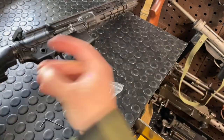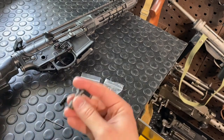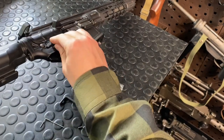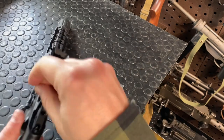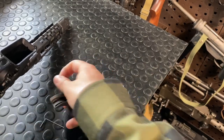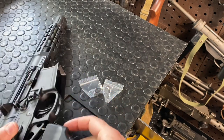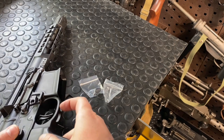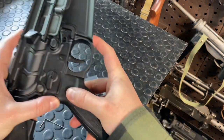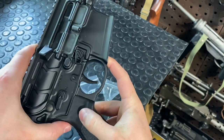We'll tap out the old detent to make sure we've got the Radian-spec one in there. First, drop the selector in, then drop in the little detent missile, swap out the detent spring from the grip and put Radian's in. Even with just hand pressure you can hear it — very positive settings. That's good to go.